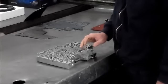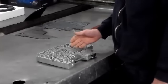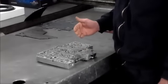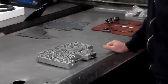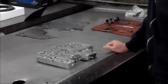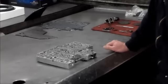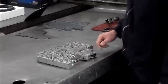Okay, also if your solenoids are mechanically clogged, you're going to get the same problem. I believe it's especially solenoid B. If that's mechanically clogged, it's going to build up pressure, stroke the 3/4 shift valve, and release the forward clutch, same problem. Also, if your control wire to solenoid B is grounding against the chassis or against something and turning the solenoid on, same thing is going to happen. The solenoid's going to turn on, stroke the 3/4 shift valve, and dump the forward clutch oil, and you'll also get that neutral on takeoff. But that particular condition is usually accompanied by a P0755 code.